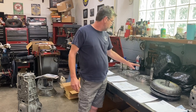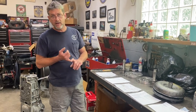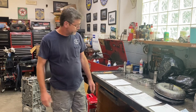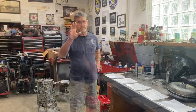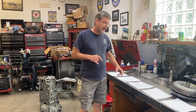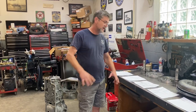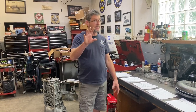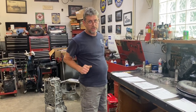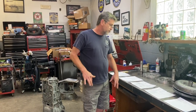I went a little bit evil with this torque converter and plasma-cut it apart. Without understanding how the torque converter works, it's kind of impossible to understand torque converter lockup systems. So we're going to do that today — learn the torque converter, mainly the torque converter clutch lockup on both on/off E4OD and PWM pulse-width-modulated lockup systems. I'm also going to show you what I found with this pump.